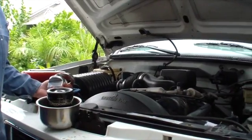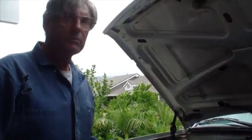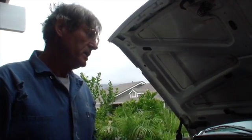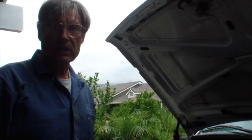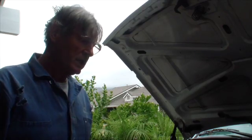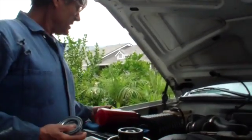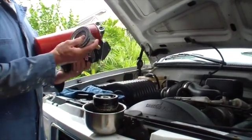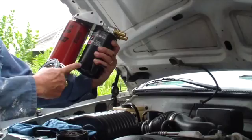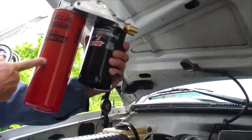We're going to do that with synthetic motor oil — we're going to use AMSOIL 5W50 oil. We selected that because when this engine gets hot, the oil pressure goes way down at idle, and we want to get the oil pressure up and minimize the wear on the engine. We're going to do that with the synthetic oil and with absolute filters found on eBay: an AMSOIL filter rated 20 microns absolute and a Baldwin filter rated 3 microns absolute.